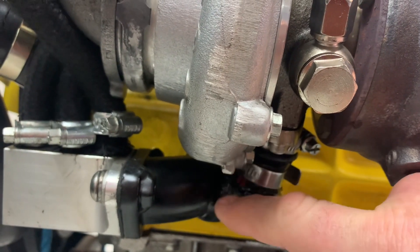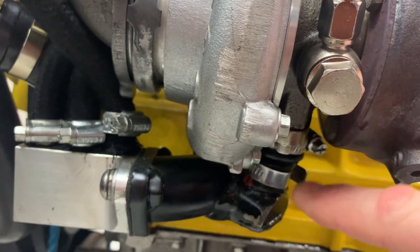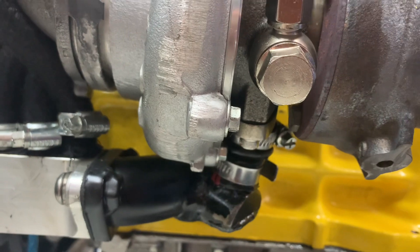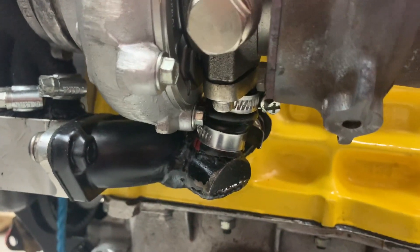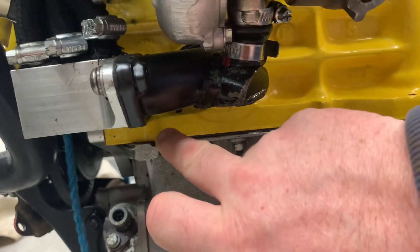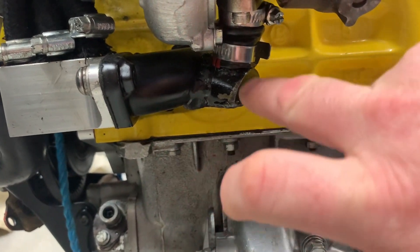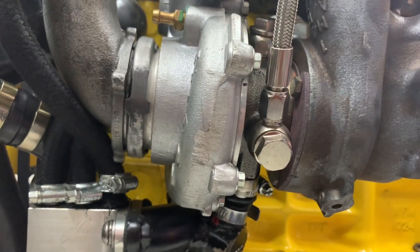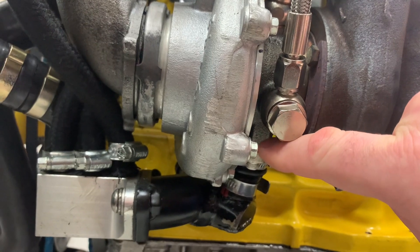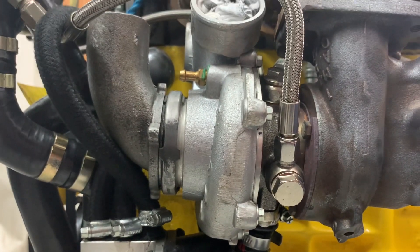I'm going to simply put a nice round fitting into the side of this elbow and a simple 90 degree elbow — a bit like the original T3 turbo was on the Metro Turbo. It'll be a nice simple elbow which allows for flexibility in the manifold and turbo movement, and it'll look so much better. My mate Anthony correctly pointed out that this centre section can be spun round, meaning it gives me more freedom and more room to put a nice elbow in here, to make a much neater and better job of it. That's what I'm going to be starting to get on to today.